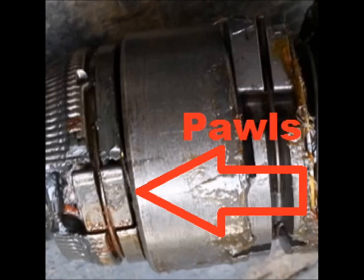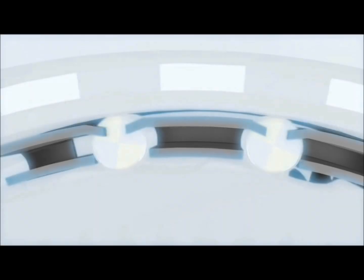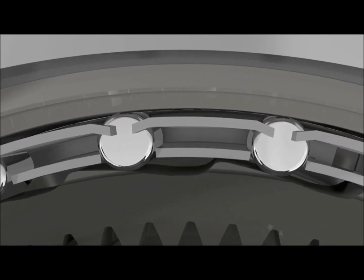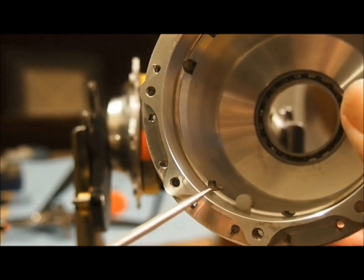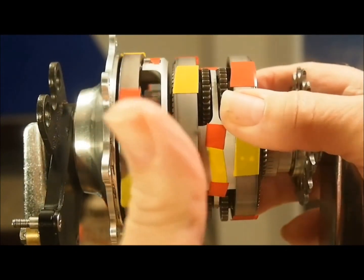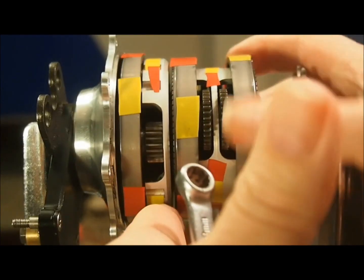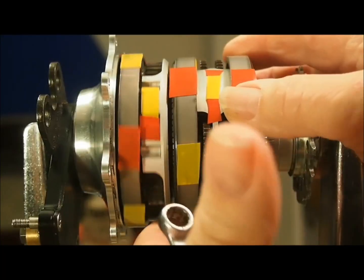The freewheeling mechanism in a Roloff hub differs significantly from other gear hubs. While others have a drive mechanism such as ratcheting pawls or roller clutches that allow the hub shell to freewheel over the internal mechanism, the Roloff has a positive engagement between the final drive and the hub shell. The freewheeling action is built into the internal mechanism itself. Freewheeling is accomplished by allowing ring gear 3 to freewheel in a forward direction, whether it is coupled to the axle in low range, or to the low range sun gear in high range. This also permits backpedaling when the hub is stationary or when rolling.